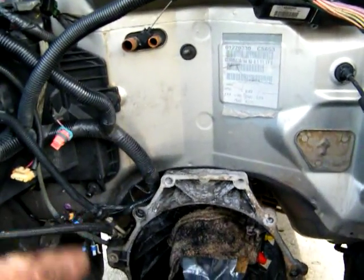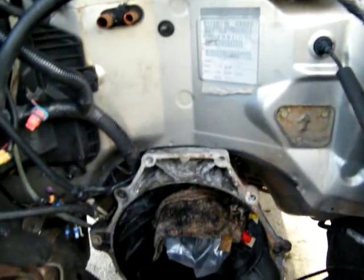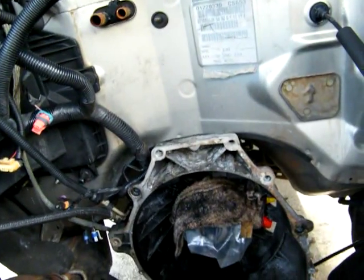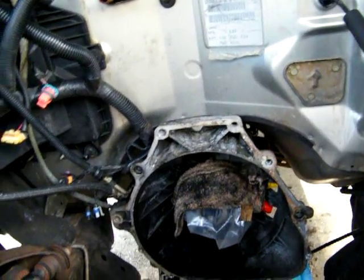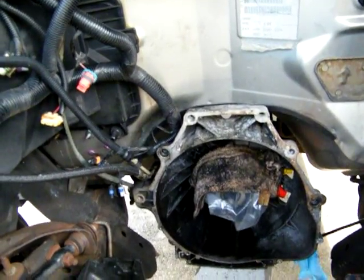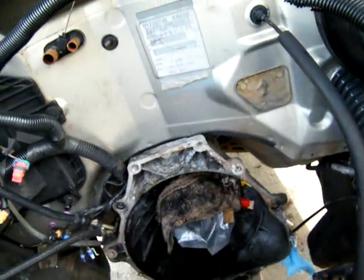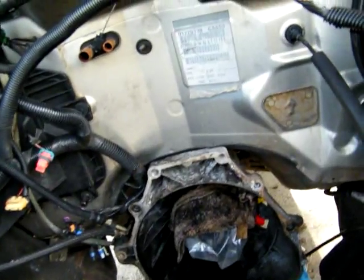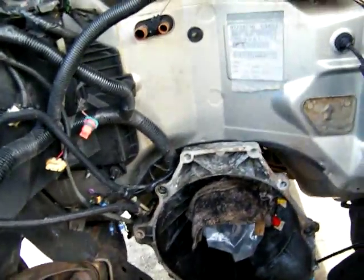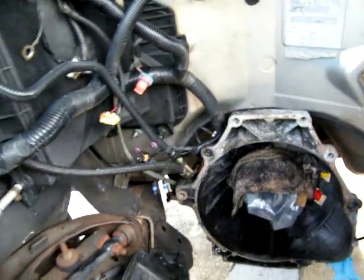Tomorrow I'll be ready to start putting a motor in this thing. I might have to loosen the transmission mounts, take them off, and slide that thing backwards some because I don't have much room with the oil pan getting it in there. I need the jacks, that's for sure. I'll get it up on the jacks, then use the hydraulic floor jack to lower the transmission up and down along with the engine hoist and the load leveler.